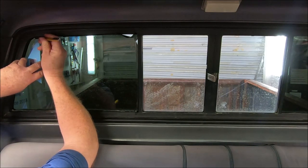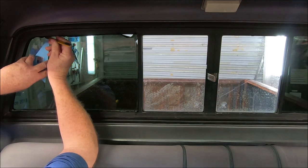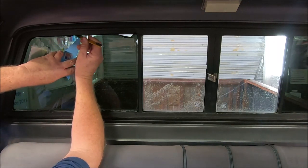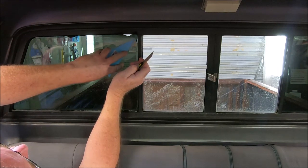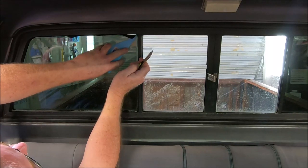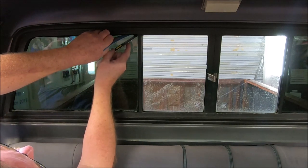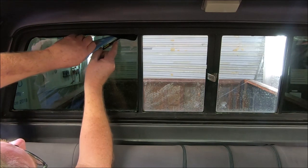If you prepped your install right, this will come out correctly. If you didn't, you're going to catch a bunch of debris. These trucks were brand new when I started tinting in '84, and we've done a bunch of them. This is an aftermarket back glass, so I cut the pattern for it by hand and oversize it just a little bit. I'm steadily working that up in there real easy — you see how it's folding up in there? If you try to jab it or gouge it, you're asking for trouble. I'll raise it up so I can see what I've got, then start trimming, bringing the frog in front of it.